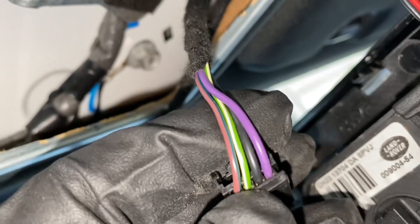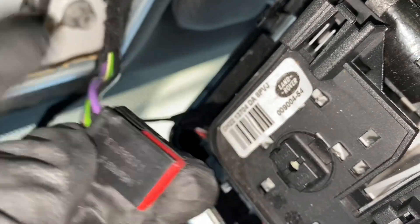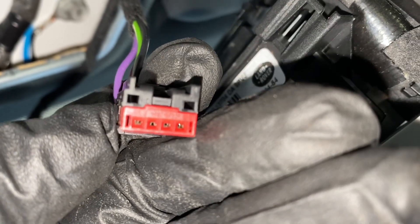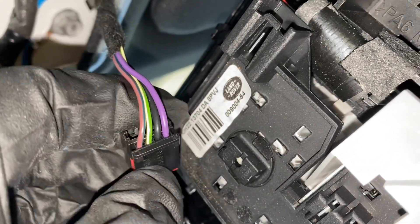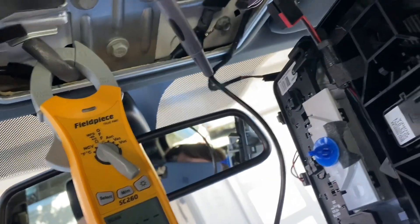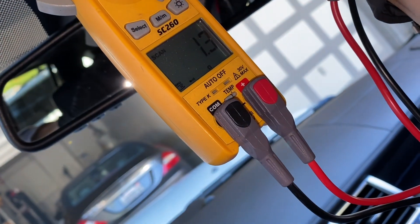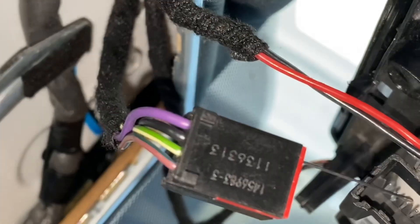Looking at these wires — some of them must be positive, some must be negative. I'm gonna put some needles in there and we're gonna test using the meter. Right now the very first step — I want to find where is my ground. I already tested it. This very first terminal which is purple: one lead of my meter connected to ground, the other connected to the needle in the plug — the purple one — and we have about 1.4 ohms.